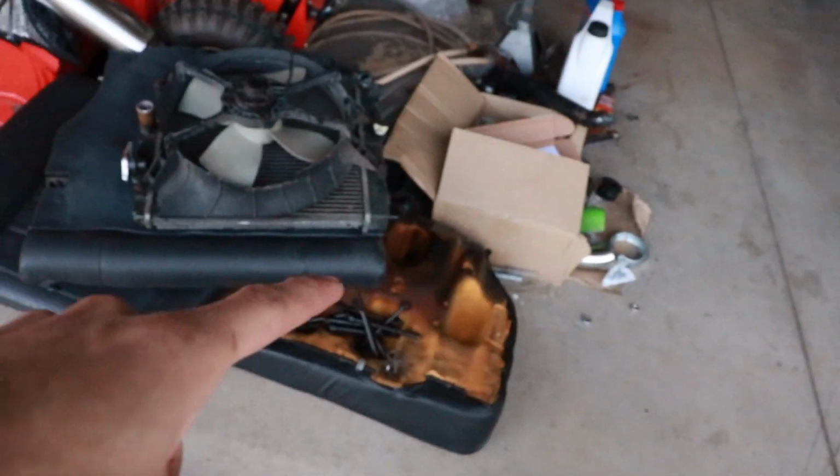The head gasket wasn't fully blown. It wasn't milkshaking the engine, but I got ARP head studs. Those are the ones that came on the engine. I did the ARP head studs, did a Cometic head gasket, and got the car running again. It felt really slow, and it was shooting like 5-foot flames when I was no-lift shifting, and I think the timing was retarded one tooth. So we pulled the engine and we redid a bunch of stuff, like you'll see in the next video.